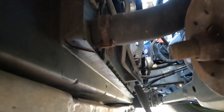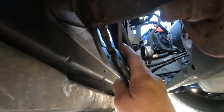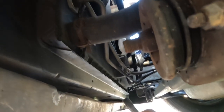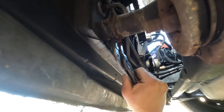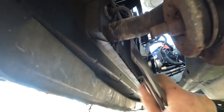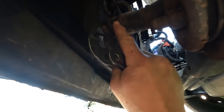So I'm going to start off by undoing that bottom radiator hose and drop whatever's in there. Just under the car to remove that bottom hose - it's got one of those spring radiator clamps. I just use a pair of multi grips and squeeze that together and it should come off. There is a tool for that that I should get around to buying but I'll get away with these. Squeeze it together and wiggle it back and forth because the radiator pipe comes to about here and the flange has got a little lip.